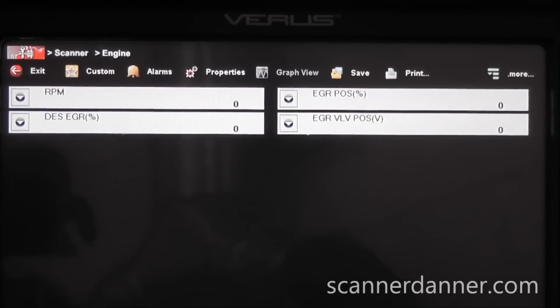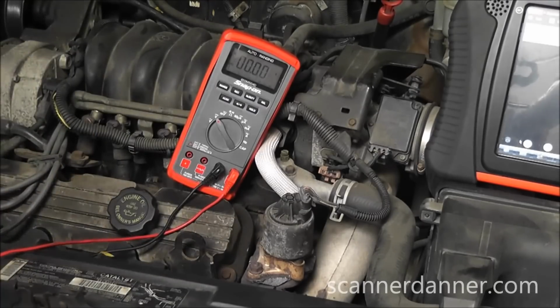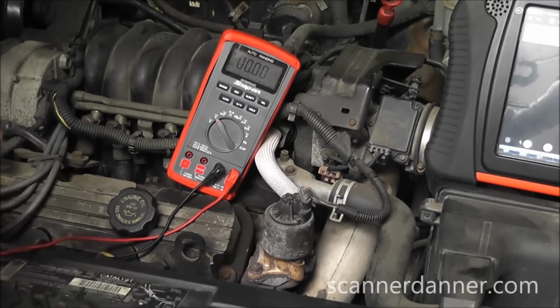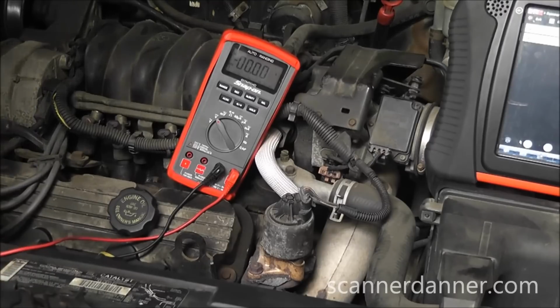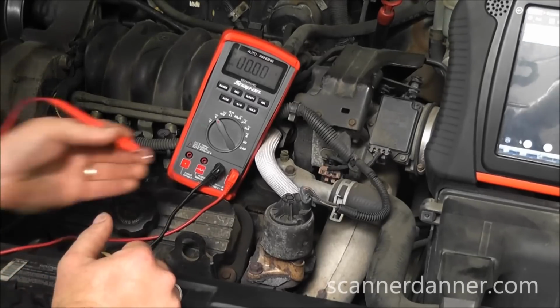And before we do the test, let me get you down on the valve and we'll talk about the solenoid. Before we manually energize this valve, we need to know if it's power or ground side switched. We can use a diagram. In this case, we're going to use a voltmeter. I have this information, section 3 in my book, transistor drivers, output solenoid. So this will be a real good review for that.